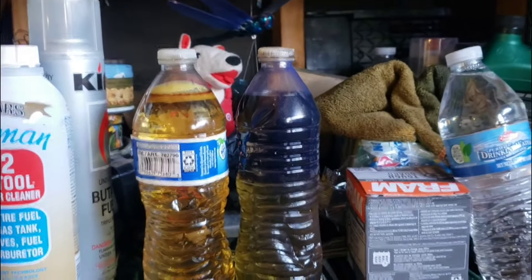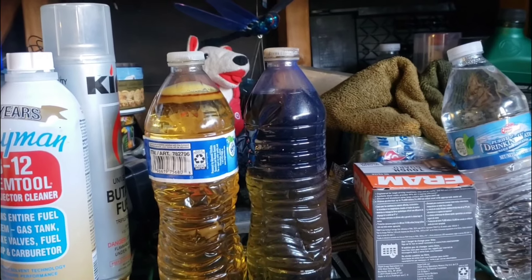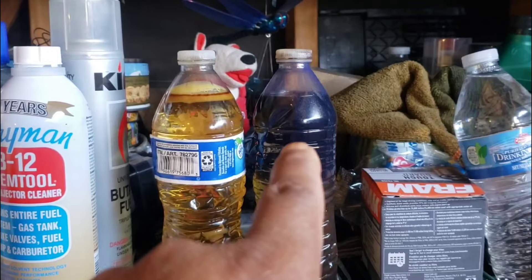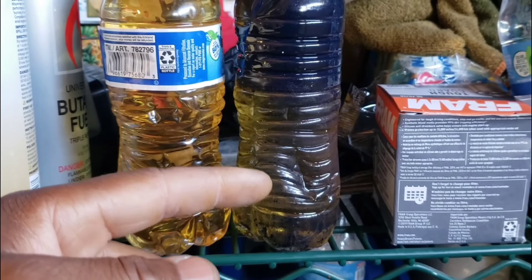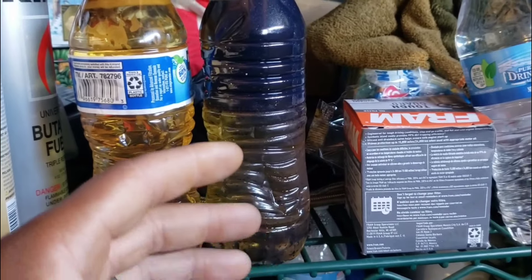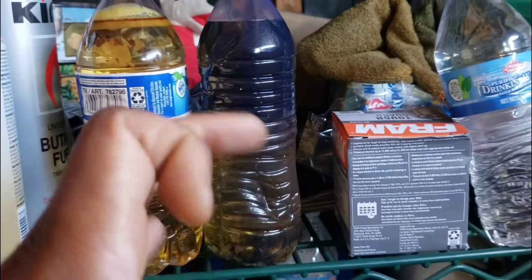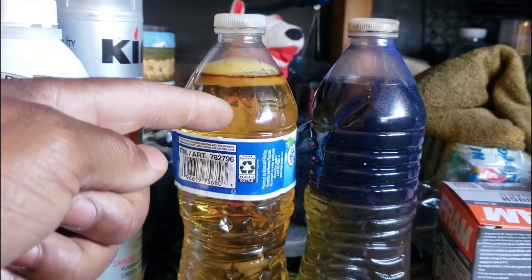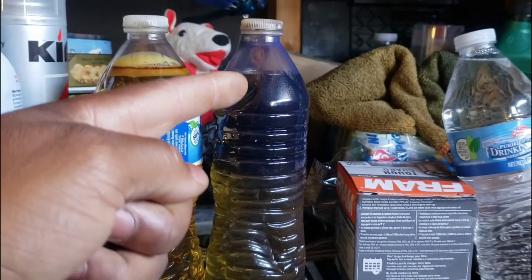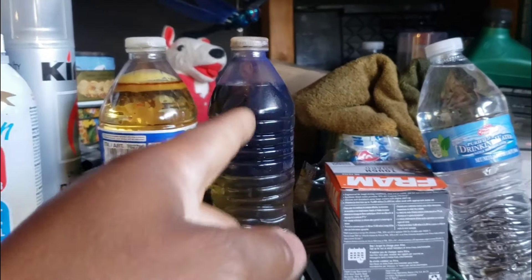This is the difference. Now which one do you think was from the back of the block? Yeah, if you chose that one, you're correct. Water and oil separate themselves — they like to be separated. It segregates itself and you'll get this divide. Of course the top portion is oil, and the bottom part is that watery liquid substance — it's a mixture, it could be oil and condensation which is water. So this one is when I was venting from the back of the block, and this one is when I was venting from the valve cover. You can clearly see these don't have hardly any oil in it, but that one — I was catching all kinds of oil. Once I switched over to venting from the valve cover, I wasn't catching as much oil anymore.